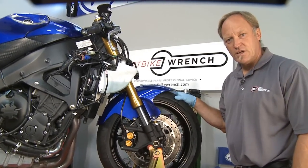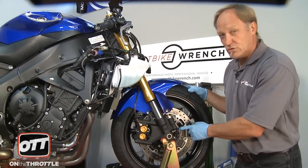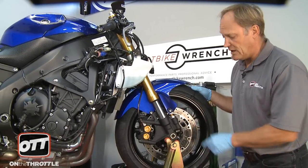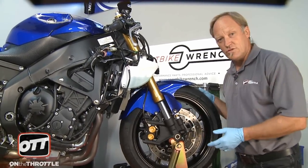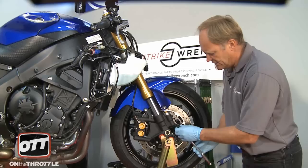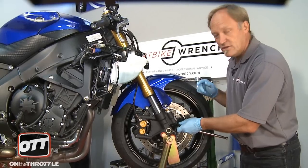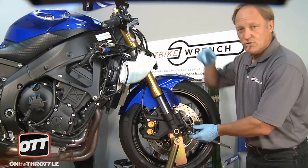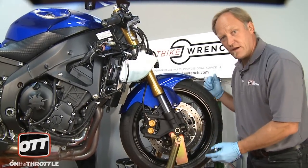Now with the 2009 R6, our brake rotor bolts are actually Torx bolts — a T40. Most of the time they're actually Allen bolts. Being prepared, we have all the equipment we need. It's great to loosen them right here, but you cannot do it yourself. So we had Dave Williams help me a little earlier — hold the front brake on, go ahead and insert our T40, and then loosen each individual bolt. Spin the wheel, crack it again and make it loose. Using the front brake will allow you to get all of the rotor bolts loose, and that's the very first thing you need to do.